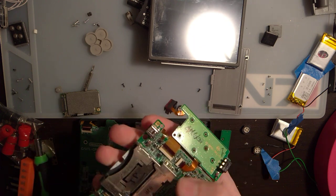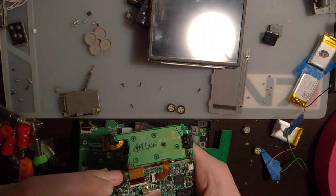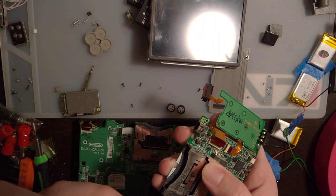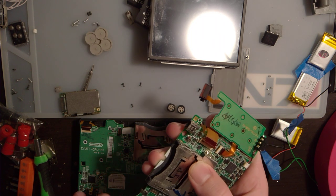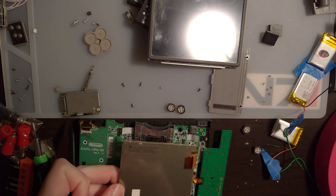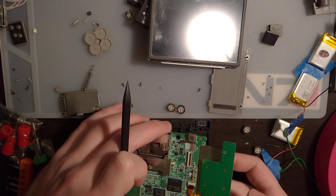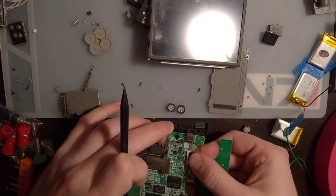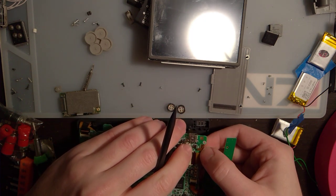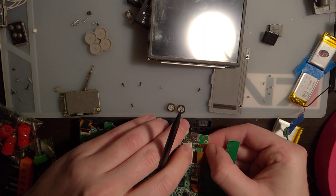We've got to do the same thing on the donor here. I was looking at replacement parts today and the DSi and DSi XL parts looked awful similar. The touchscreen is probably not gonna line up — I won't be able to plug it in — but that's okay, we don't need it. We just need the backlight and the main ribbon to try it out. The backlight ribbon doesn't really line up, but we'll make it work. The other ribbon's not even gonna come close.